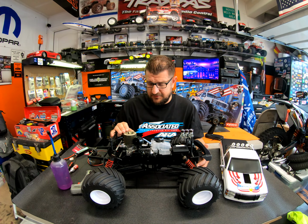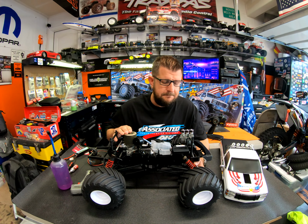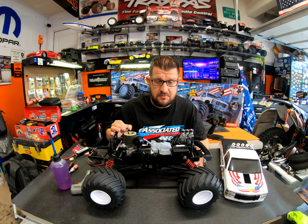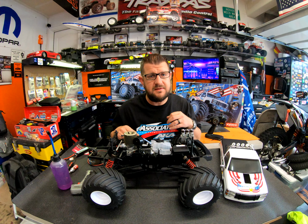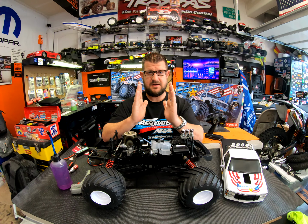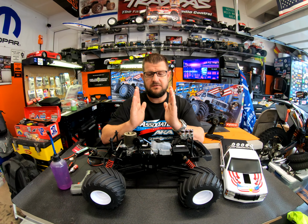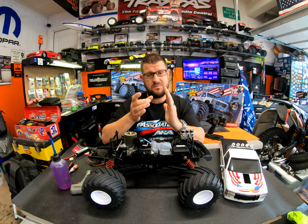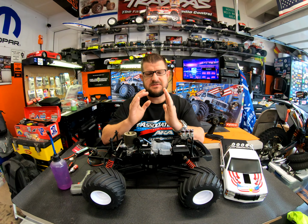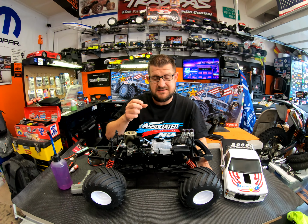are critical. And the reason heat cycles are critical is really just the nature of how these engines work. So these engines don't have piston rings, so their compression relies on a press fit, basically. So the cylinders of these nitro engines are actually slightly concave. As opposed to a regular engine that has parallel cylinder walls, these nitro engines have tapered cylinders. The walls aren't parallel, they're slightly tapered at the top, and that's what we call the pinch. That top tapered section of the cylinder is where we get our pinch or our compression. So when the piston comes up, it's in that pinch, that tighter area of the cylinder, and that's where we get all our compression from.